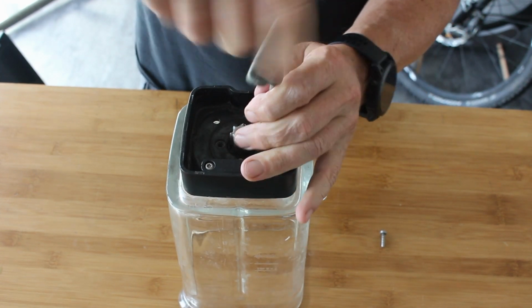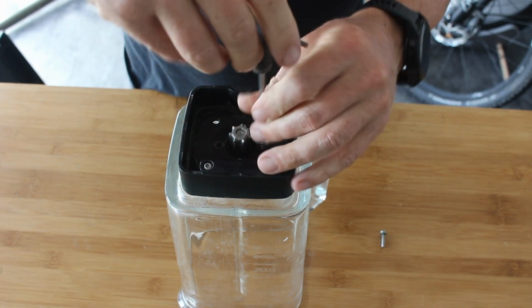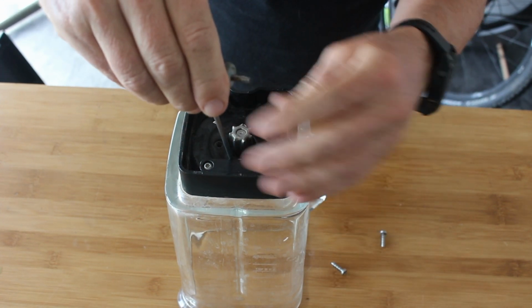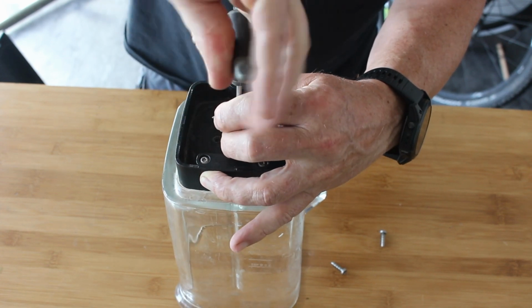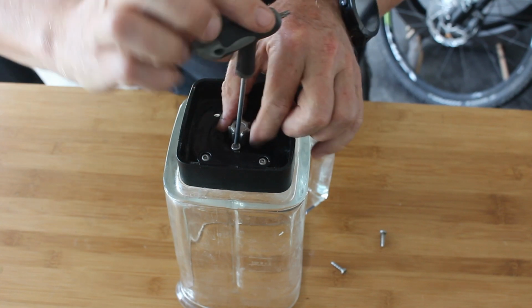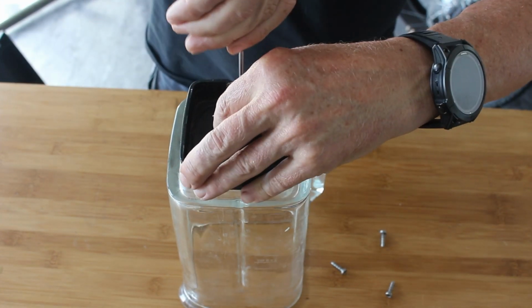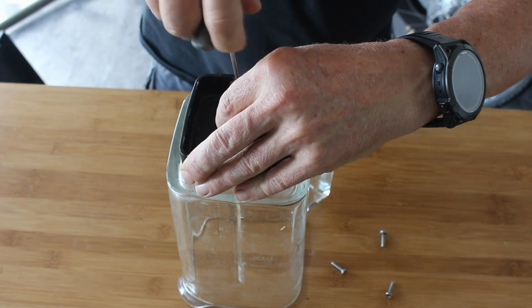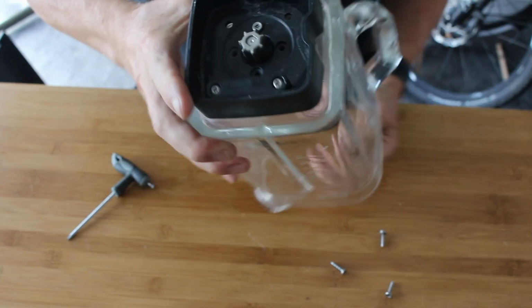Yeah, it's really crunchy. It's not completely gone yet, but when I took it to pieces, there was just a whole load of stinking, rusty, fruity kind of liquid all in it, which is bad enough, that liquid getting through, because it'll wipe the grease out, but the fact that most of it is citrus means it's just eating it alive. So the bearings I've bought, you'll see, are ceramic, so they should last longer and spin better.